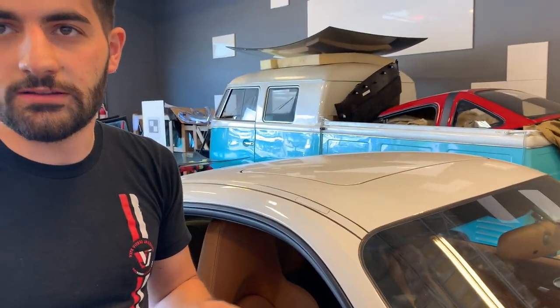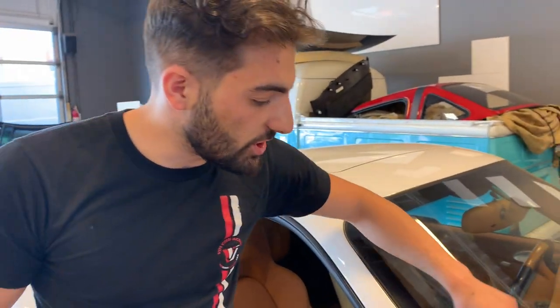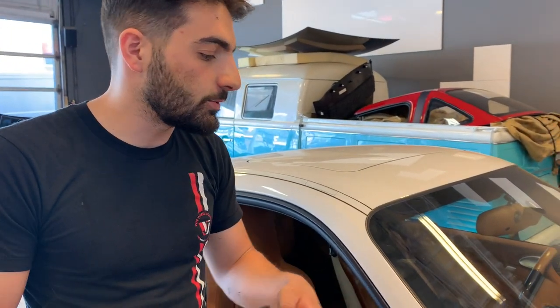Obviously, it has a risk because the windshield is used and everything, and it could create a crack. Let's say you had a small chip on the black edge. Sometimes when you pass the wire, with the stress you put on the glass, it could start to crack and go further that way. So that's what we do when we save a windshield.